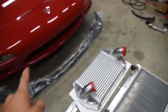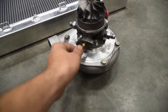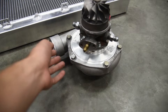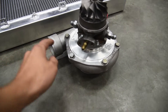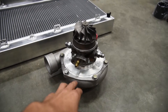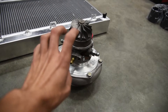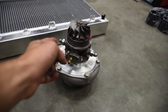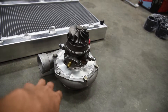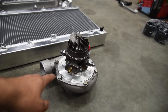Because when we do put some fitting tires on here, unfortunately they stick out so far we'd have to raise the car up, and I refuse to roll these fenders. So the bumper lip will just give a little bit of ground effect until I figure out what I'm doing with my wheels - but it looks cool anyway. And this is our rebuilt turbo - the GT3574, essentially a GT35R but a journal bearing. We put all new oil seals in it. It's ready to rock - super cheap rebuild, 240 bucks. You can't beat that.